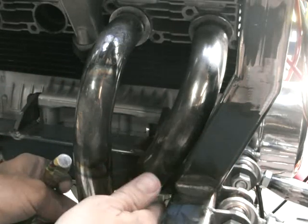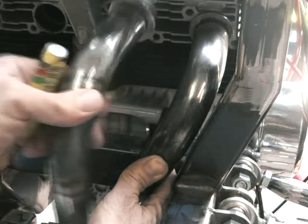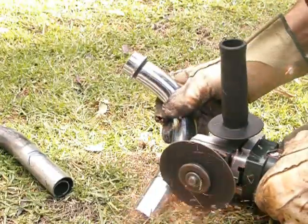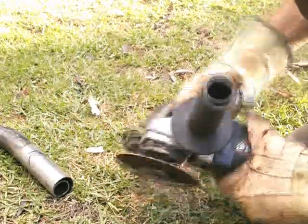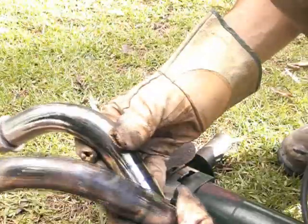Just starting off here, marking it up. It is very tight and needs to be quite accurate. I'm just going to scallop these two pipes and tack them up, so it'll go two to one at that point and then one through the frame. You'll actually notice that Suzuki have made these pipes as a pipe in a pipe, or a tube in a tube, just at the front half of the manifold. I'm not 100% sure why they do that, but I wanted to keep that front section. It will certainly reduce some of the heat, but I'm not sure if it's heat or sound or what the reason is.